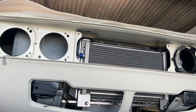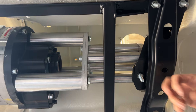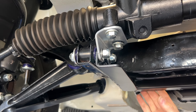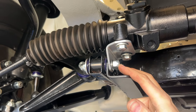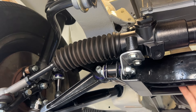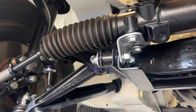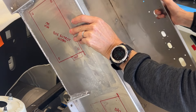I'm really happy with the way the motor's gone in. We're using the original prop shaft and a 120 kilowatt motor through a two-to-one reduction box, giving us 600 Newton metres to the drive shaft. We've taken the whole motor frame mount back onto the steering position up front here, so while it's a little convoluted going back underneath the cross member, it means we have a positive position to bolt into without cutting into the car.